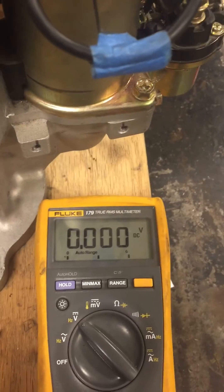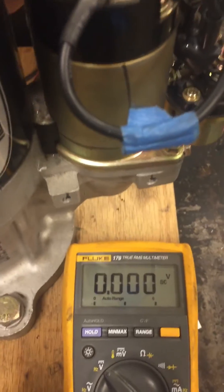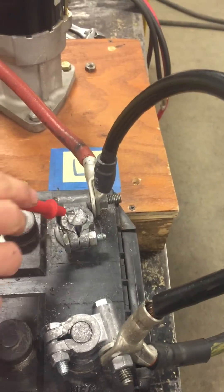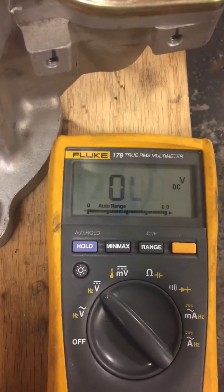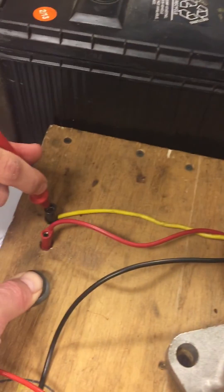That's good because that means it's not open circuit. So now what are we going to do? Voltage drop the positive side — go positive over here to positive. We activate the circuit and it still shows open. So now follow that wire down and do a halfway on it. Follow it on down to here and go from there to there. I activate the circuit and I have an open — in that wire, from lead to lead. So from here to here I have an open.